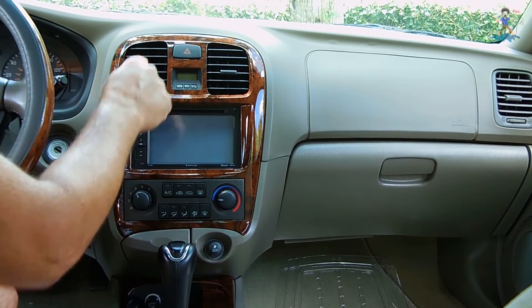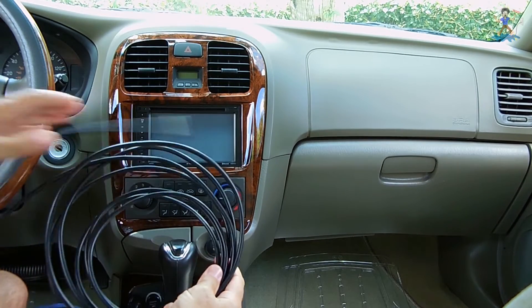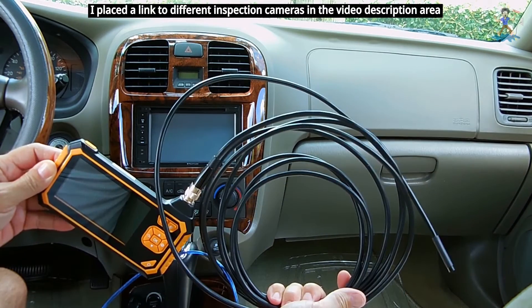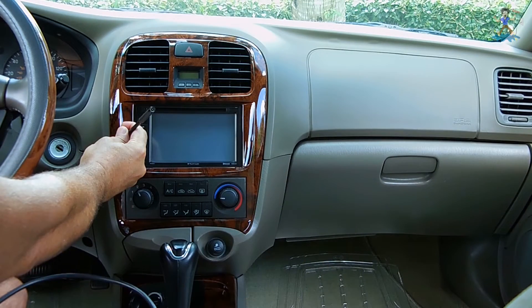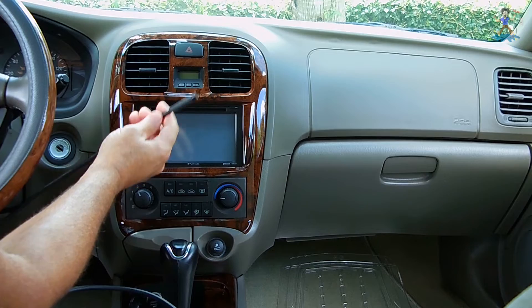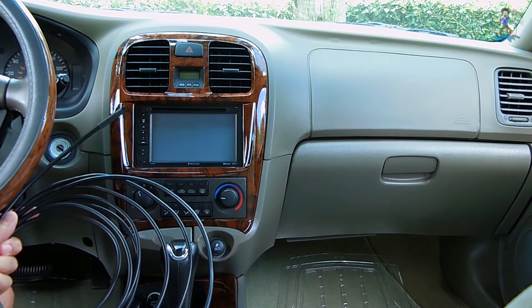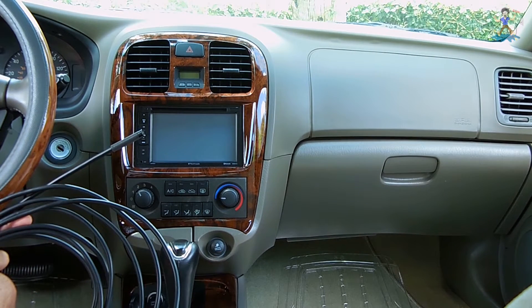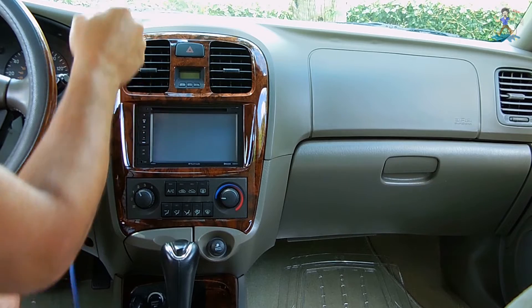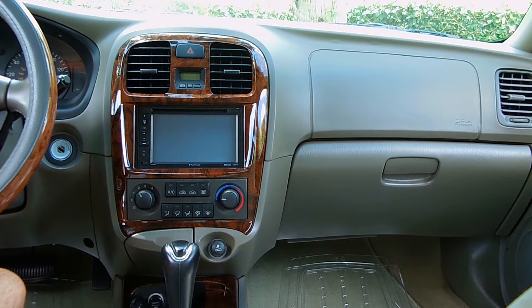What I need to do is take a look inside this housing using an inspection camera. You don't have to use a higher-priced one — this one has an SD card, does video and still shots. You can buy a simple one for your cell phone, but it's very important that yours has a very bright LED light with the camera and that it's very small. Because the inside of that plastic housing is black, I'm going to insert this light all the way into the vent to give extra illumination so you can see exactly what's going on behind the center console.